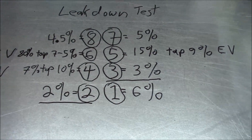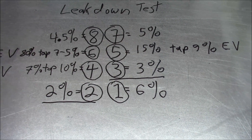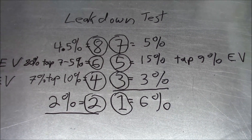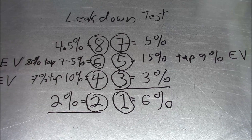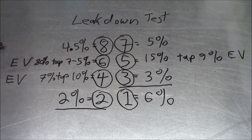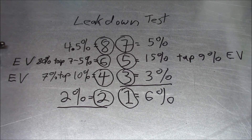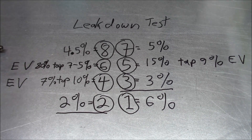If they don't improve, it's probably something worse. Back to the results: cylinder six improved all the way down to 5%. Cylinder five started off kind of bad at 15% but improved to 9%. Cylinder four actually got worse, going up to 10%. Since I plan to pull the heads anyway, I'll lap the exhaust valves on the bad ones — maybe I'll lap them all. Technically I'm supposed to get a valve job, but this is a budget build so I'm just going to do what I can do at home.